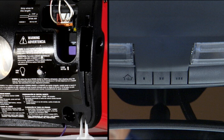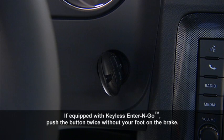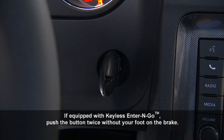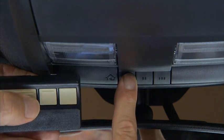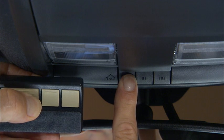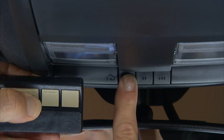A quick note: if your garage door opener was manufactured before 1995, it may have a non-rolling code. To begin programming a non-rolling code, turn the ignition switch to the On Run position and hold the battery side of your handheld transmitter away from the HomeLink button you wish to program. Place the handheld transmitter 1 to 3 inches, or 3 to 8 centimeters, away from the HomeLink button while keeping the EVIC in view. Simultaneously press and hold both the chosen HomeLink button and the handheld transmitter button until the EVIC display changes from Channel Training to Channel Trained.